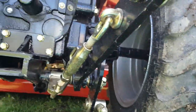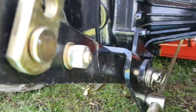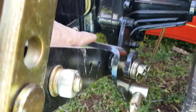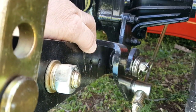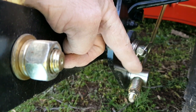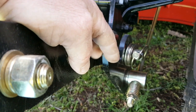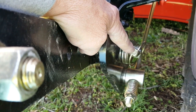So when you get your deck, you get a bracket. This is one of the brackets right here. It sits on the back of these two arms here for your hydraulic. And then you can see the spring right there - I'm pointing at the spring. That spring and that shaft goes all the way up and connects to the deck. You can actually take these off very quickly too. It's got a quick connect pin right here.